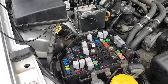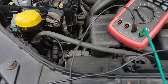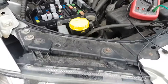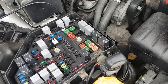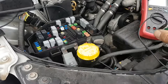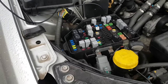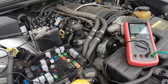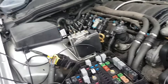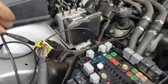The duty cycle for the heater ground comes from the ECU. The only way to be 100% sure the ECU is commanding that sensor is to back-probe the ECU, which lives underneath here, or find where the wire comes through. Checking the pink wire with blue stripe - I need to find where the other wire routes before the ECU. The other wire I identified is a plain brown wire which comes here. So to back-probe I just need to find the pink and blue.